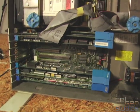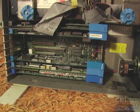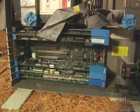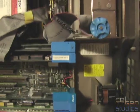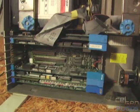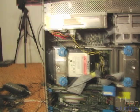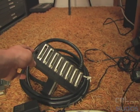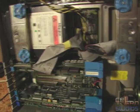The other cards installed: above the AST card is a Token Ring card, just for the fact that it's a Token Ring card in an IBM. Above that we have the 3Com Etherlink MC network card. At the very top is the Multi-port 2. What this did is give you the options of either an X.25 interface or, as I have here, eight additional serial ports, which you could use with AIX to run multiple terminals. Because it contains a 186, it's also a programmable board, so there are a couple other things you can do with it.